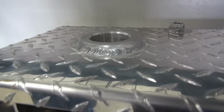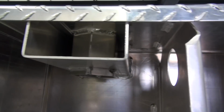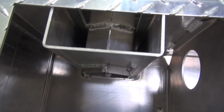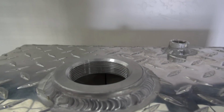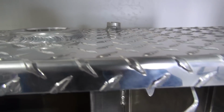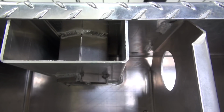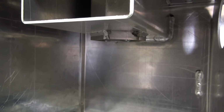If you get the fuel box option with the manual transfer pump for your tractors, you get a much better system here. This actually is a reinforced neck tube that your regular pipe would go in there for your filler pump, not just a ring welded on top, but a reinforced tube coming down to keep that pipe straight and not going to break off on you. This is a much better design from Fuel Box.